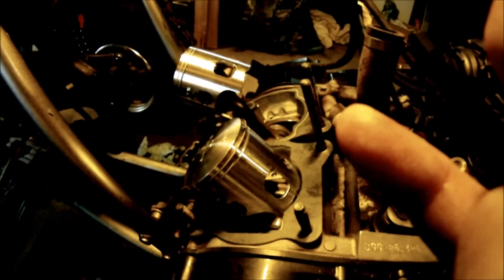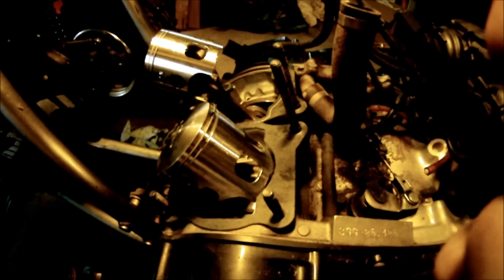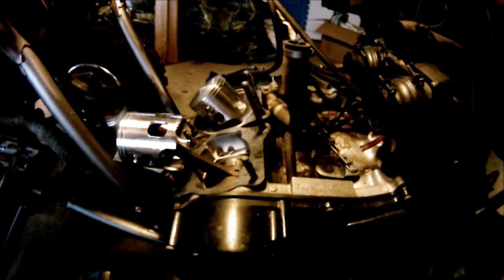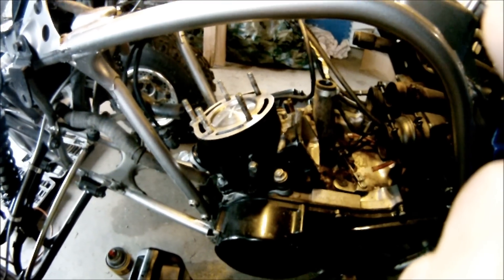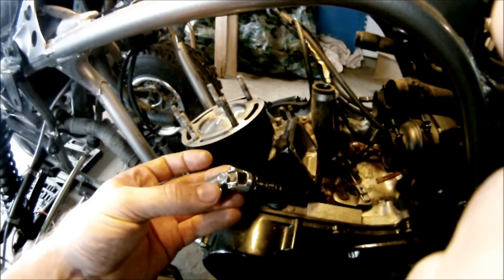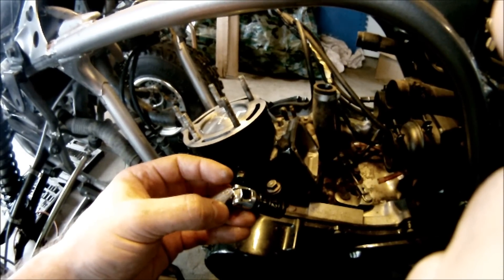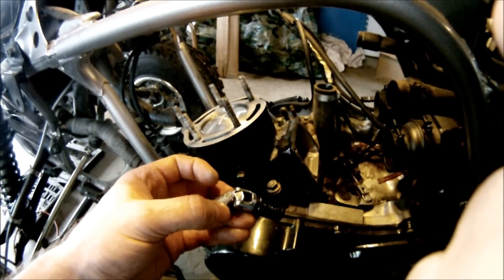You're going to have to compress those piston rings on top of those holding pins at the same time that you slide the cylinder on, so you might want some help when you do this part. I'm also going to put some anti-seize on all of these bolts that stick out. That's the cylinder freshly sat on there. The torque spec for these nuts is 20 foot-pounds — it's a 12 millimeter nut. I'm going to use a swivel adapter, and since the swivel adapter absorbs some of the torque I'll go a little higher — about 25 or 30 foot-pounds.